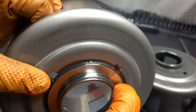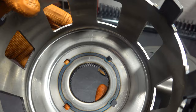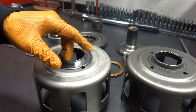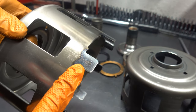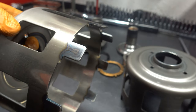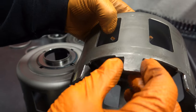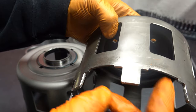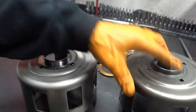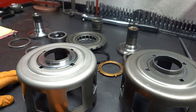The splines are heat treated, the surface area for the bearing is billet and heat treated, and the back is also heat treated — so through and through it's just a much stiffer piece. You'll also notice the engagement lugs that spline into the reverse input drum are heat treated on the Sonic shell. There's no heat treatment on the corresponding lugs on the factory piece, and those like to wear out, which gives you a real noisy transmission.